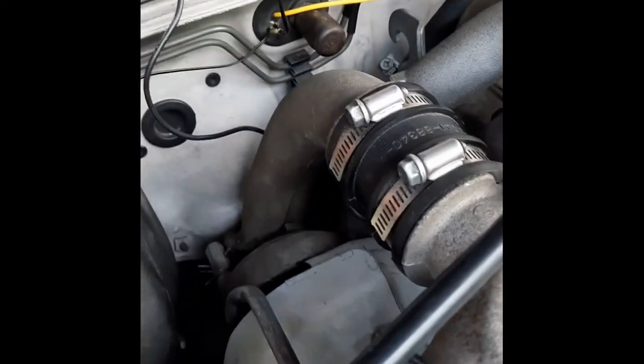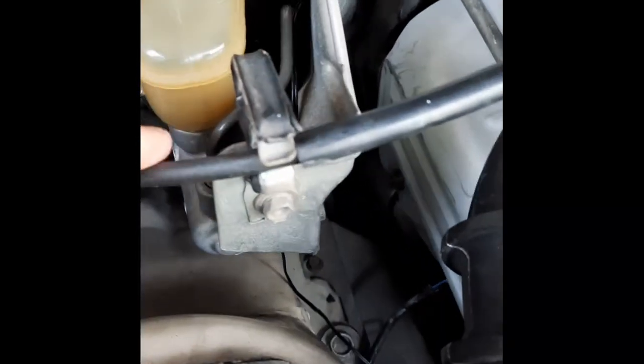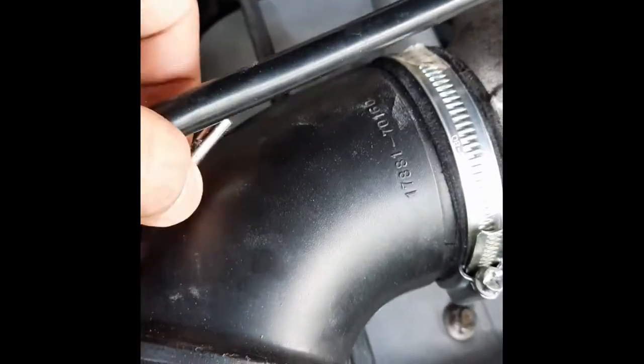Alright, it's going that side. I'm gonna have to put a trunking on it to protect it, and the temperature probe wire is here, going behind this brake booster shield. And I will find a good place to position this above the turbo shield. It won't be touching the shield, but it will be above it, very close, somewhere here, so as to measure the air temperature over here.